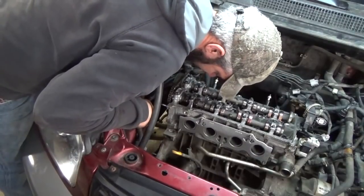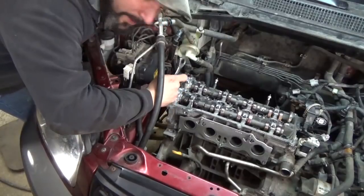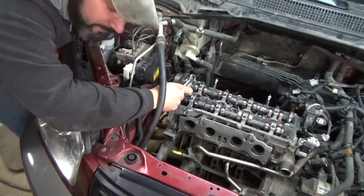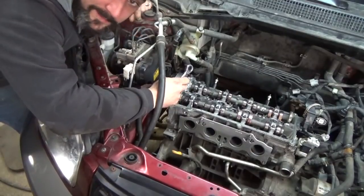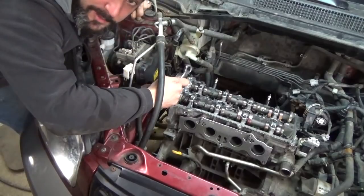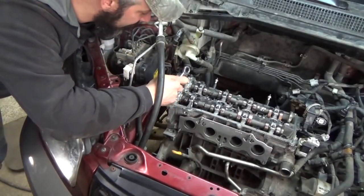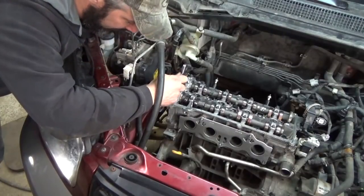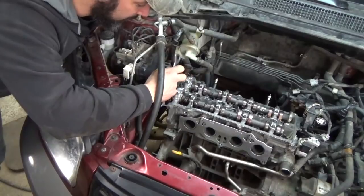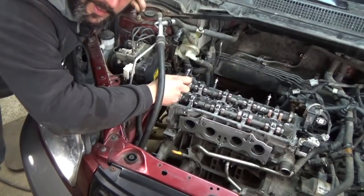I mean, it has to be right, even if these marks aren't 100%, because it's going off a tooth count from chain to chain, or from link to link, with the gold links and the colored links, so it has to be correct. There's no way to theoretically be a half a link off or anything of that nature. So I'm going to grab the other chain guide, we'll get that put in. I'm going to get tension on stuff, and I'll get the camera a little closer, we can have a look.